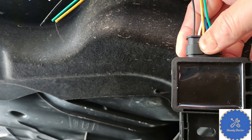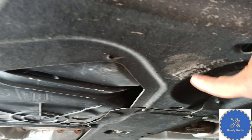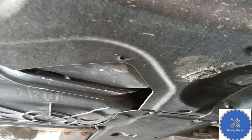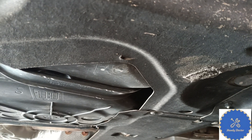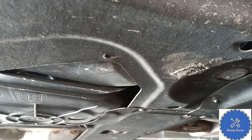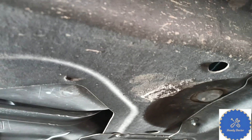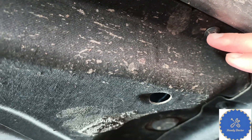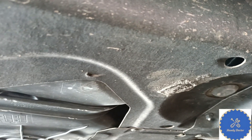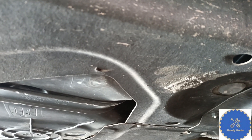Let's go to the car. The temperature sensor module is installed on the side of the gas tank. That's why right now we are right in front of the rear passenger wheel, and you need to take this panel out. The sensor is actually right on top of this location. For the Q7 at least, you don't need to jack up the car, but if you have a sedan, then you probably have to do that. To take out this panel it's rather easy — there are nuts out here. This is one of the nuts, this is another nut, and then some T25 bolts that you want to take out all the way — about 10 of them.